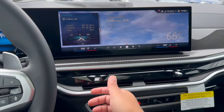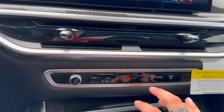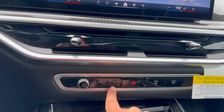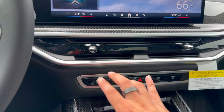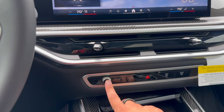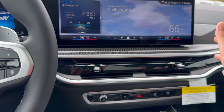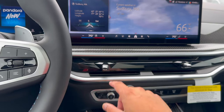The only physical climate buttons we have are the two defrosters, front and rear. We have our hazard lights and a track skip button. We have our volume knob which you can push in to mute. If you ever have phone connection issues or a frozen screen, hold this down for about 30 to 35 seconds, the screen will go black, and then let go — this reboots the whole system. You can also use this button to turn off the screens by holding it for about three seconds when the engine is off.